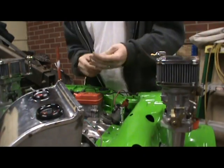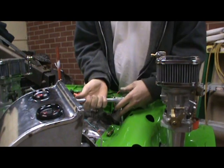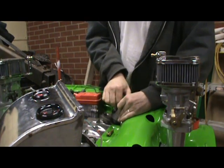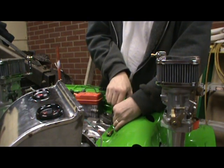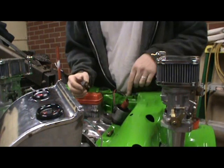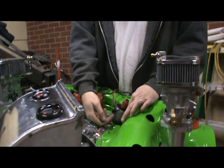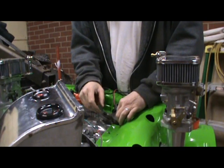What I'm doing right now, I've got to get this stem down in my block. This is for my oil pressure gauge — I'm using a manual gauge on here. I'm going to get the sending unit out. Ultimately what I'm going to do is plumb it to use the idiot light or factory oil sending unit, and I also want to plumb it for my auto meter gauge, which I have in the van right now. This is kind of buried in here as you've seen in previous videos. I'm going to use the extension, come up, make a 90, and then I can have the oil sending unit plus the bulb. I'm going to try to move it back this way where I can have better access when I really do plumb it in.